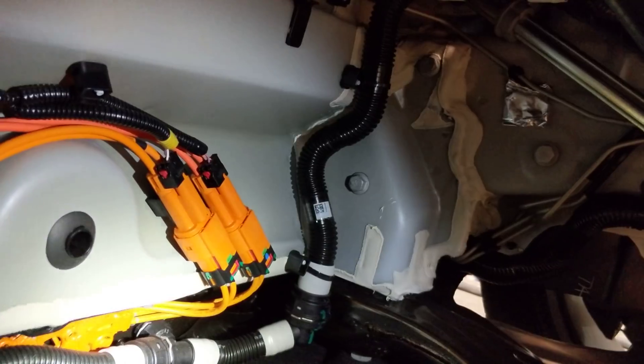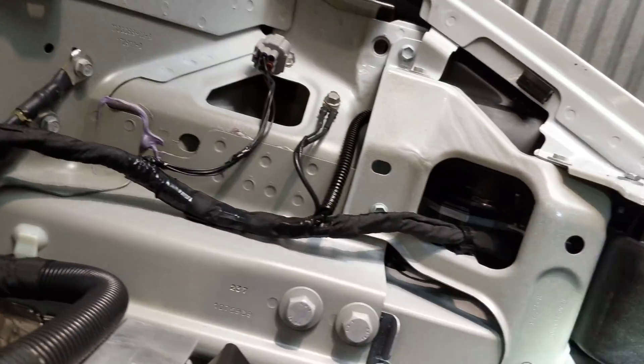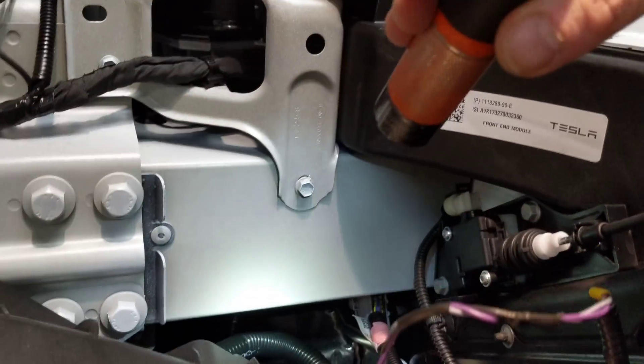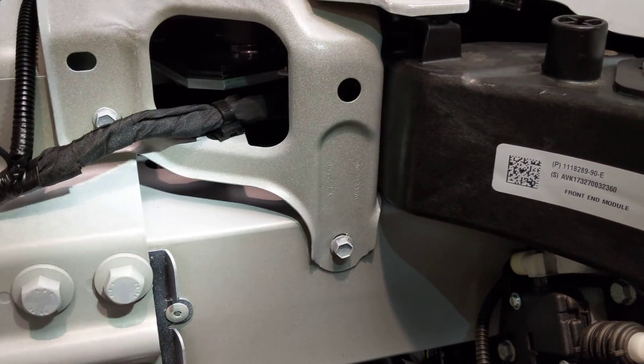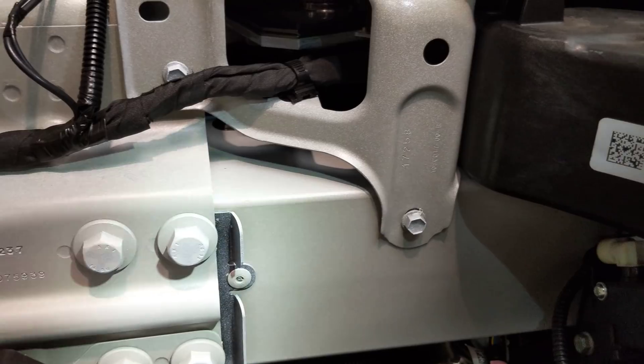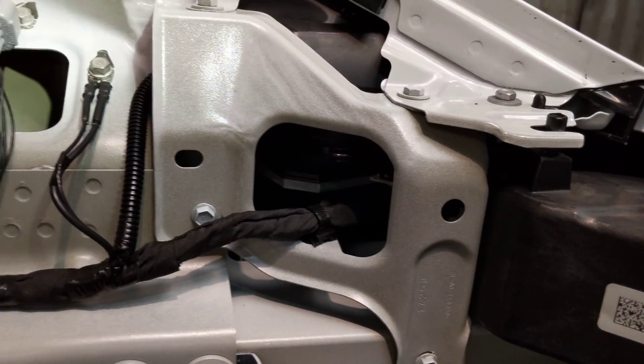The DC-to-DC is integrated in the penthouse under the rear seat, which is part of the battery. And it looks like the crash structure — the box here — is unboltable, which is nice. So if there's a crash and it doesn't damage the rest of the structure, you can unbolt that and put a new one in. Repairability.